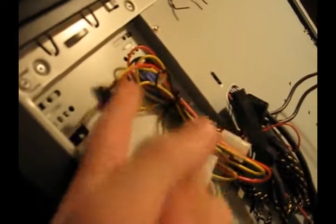Just open, flip the switch, and then put it back on. The power reset and LED switches are easy to do. You just take it right up here and put it through the top hole, pull it out the bottom hole, right down there, it comes out, and then just hook them right up. Just check your motherboard manual to see where each little one goes.